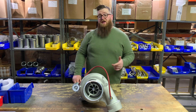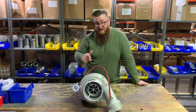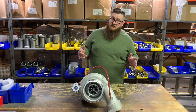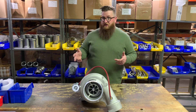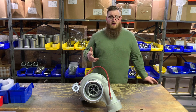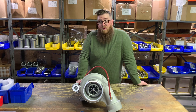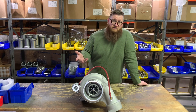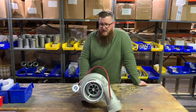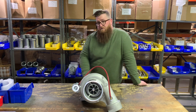Right off the bat, there are a couple of things that are clearly evident. One, this turbo has a billet wheel. Two, it's a caterpillar style compressor cover. And three, it's got a wastegate actuator on it - this is an internally gated turbo. What we're looking at here is basically the famous quad zero or 78 millimeter 132 turbo, but with a wastegate on it. This isn't going to be everyone's cup of tea - there's a lot of guys that like the non-wastegated version, and it's been a super hot seller. But we often get calls from guys looking for a wastegated 132 housing, because the only wastegated housing really available for these 96 millimeter turbine wheel turbos is a 165. So this is a first to market from Zeki with this 132 gated housing. Let's pop the cover off and jump into some of the features and benefits.